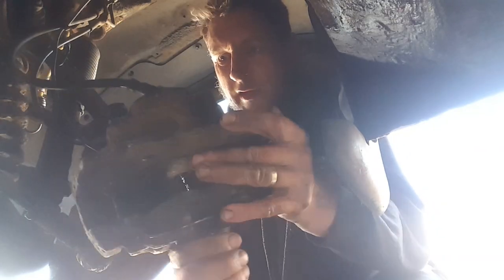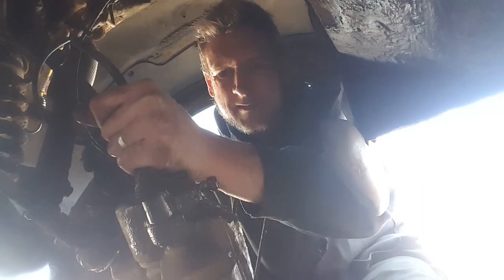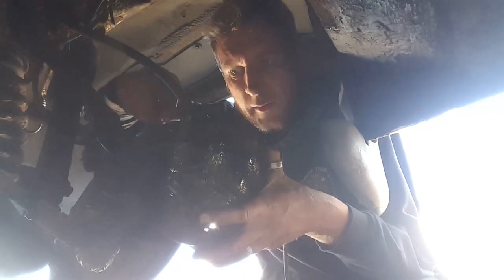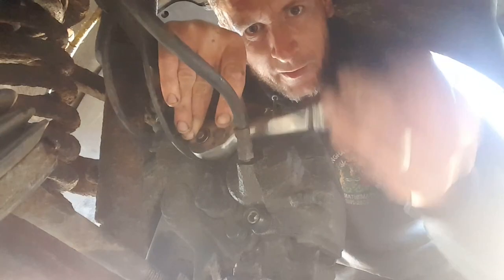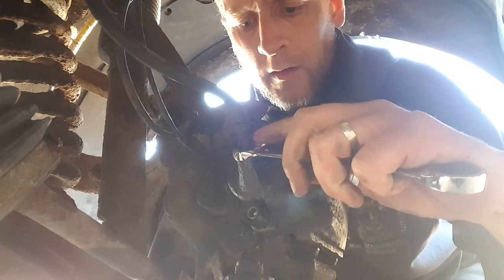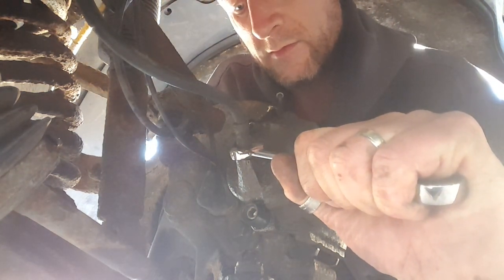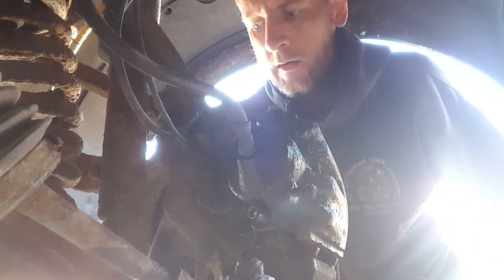And on — this one's got the cradle attached as well so it's a bit heavier. So just to show you what it is I've got to do: it's a case of holding the hose here and then spinning the entire caliper and cradle around the thread. It gets so far by hand, and at that point we can tighten it properly using the spanner. So now let's get it back onto the hub again. Let's hope we don't have to take this off again. And then finally just to get the 14mm spanner on the ferrule of this brake hose just to nip it up — remember not to over tighten. Fantastic.